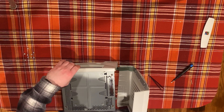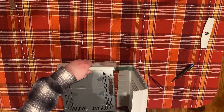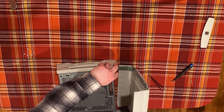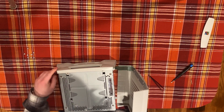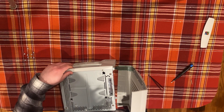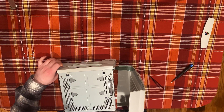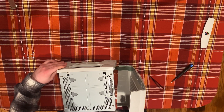Going around the front of the case, there are 4 plastic clips holding the front bezel onto the main chassis of the machine. With a guitar pick, spudger, or your fingernail, gently release these clips and pull the front bezel away from the main chassis. Once the 4 clips are disengaged, the bezel should slide off the front of the machine.